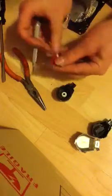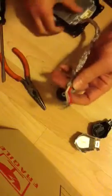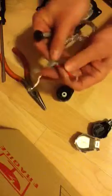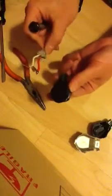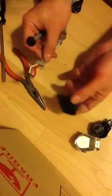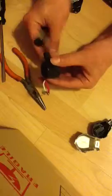And that's it. At this point, if you're in your headlamp housings and you have the HID wiring there, you can fish this carefully through the housing, and you'll be able to pull out the entire ballast and wiring without an issue. When you're transferring, you reverse these steps and reinstall the cover and shield once you put the wire inside your new headlamp housing. Good luck!